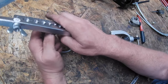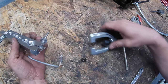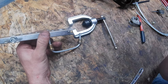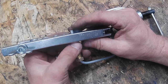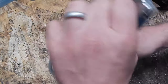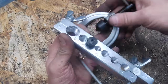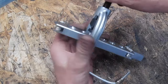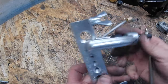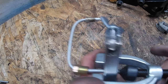The double flare is a little different: the first step is it's going to crimp it down, and then you're going to use the flare tool to push it in, so it's actually double wall thickness right at the flare. You extend the pipe out of the tool at the thickness of your double flaring button. This goes down inside, then we tighten it down — that just rounds the edge a little bit. Now that the first step is done, we take the flare tool, put it back on, and that creates the actual angle to seal the fitting.